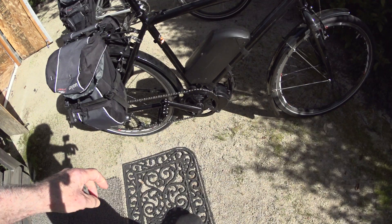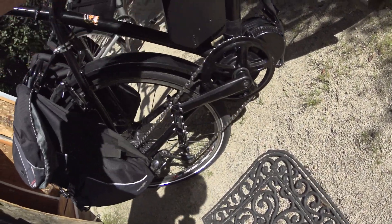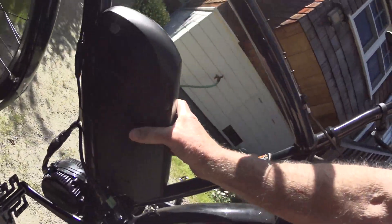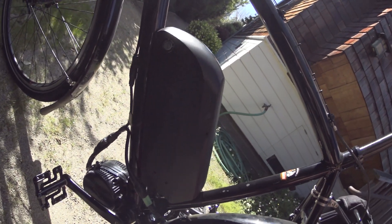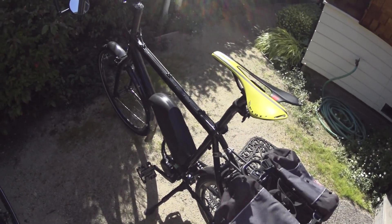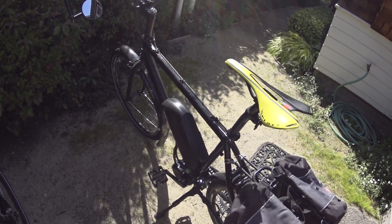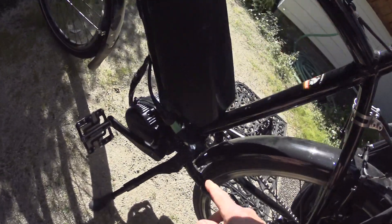This mid-drive bike has a 17.5 amp-hour battery — this one is pre-made and it has a lock, so I can pop this battery pack off and take it indoors, which I typically do in the wintertime. You don't want to leave your batteries out in the cold; it deteriorates their performance. Plus you don't want to charge a bike ever under 32 degrees — it will ruin your battery.